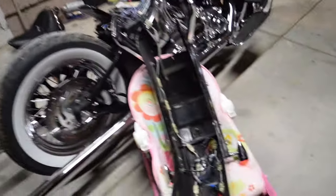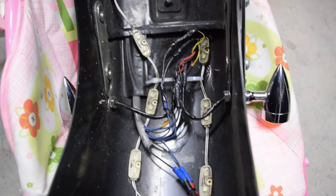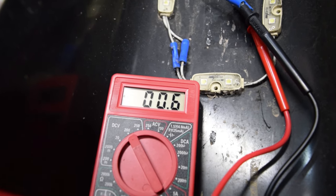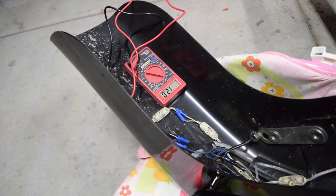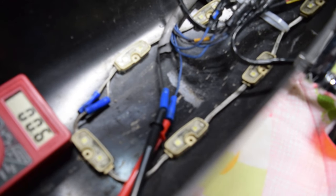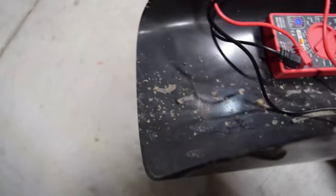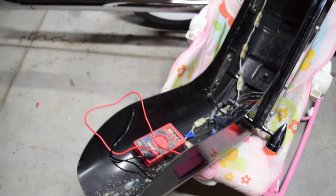Moving on to the tail light wiring - as you can see, this is the jumble of wires the previous owner has left me. For our turn signals there were these two wires here - a black and a blue wire. I got my meter on it right now, the ignition is on, and we're running 0.6 volts. I'm gonna go ahead and tap the brake - there we are, 12 volts off the brake, and we lose the voltage. We'll try the front - there's our 12 volts. Perfect, looks like he made it easy. We got the two wires right there ready to go and we'll be able to wire up our new tail light. It'll just run down and connect down here.